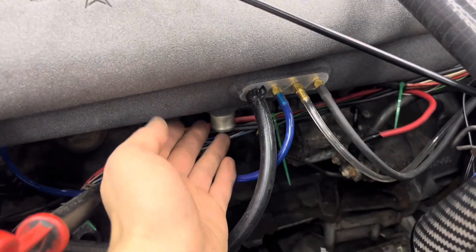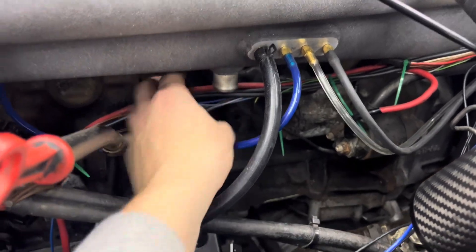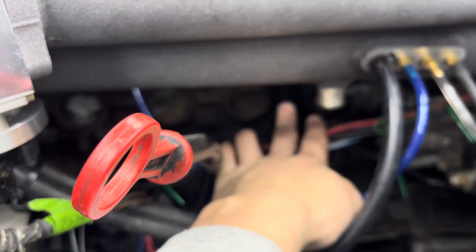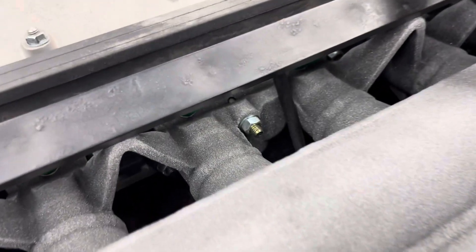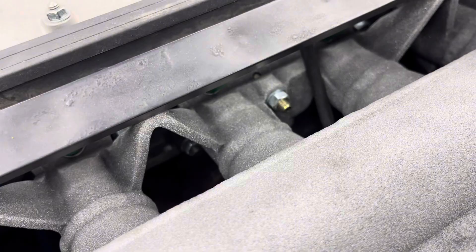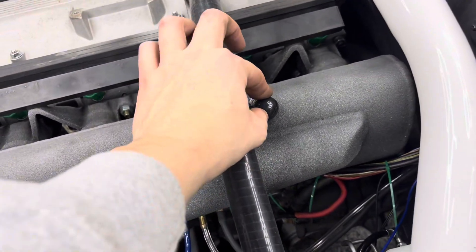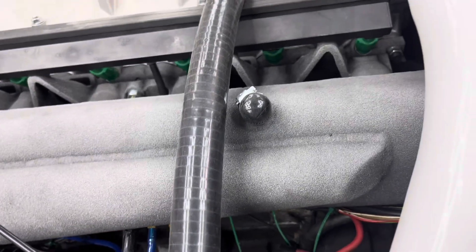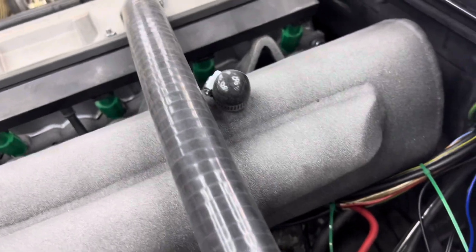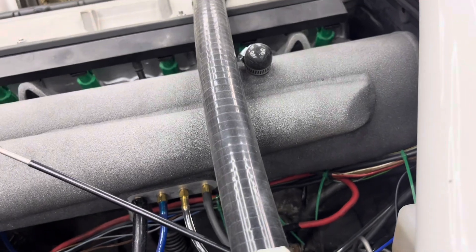That tube is plugged — you'd have to drill it out if you wanted to use it. Under there where the breather tube is, the fitment for that was just fine as well. I don't have any leaks or issues there. There's also a little port here for the factory brake booster that is pre-drilled out, and I did have to buy a little rubber bung on Amazon and a hose clamp to clamp that off. I've had no issues with that.